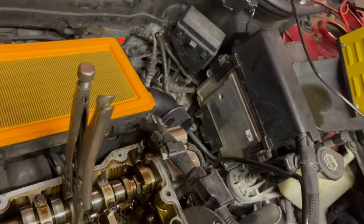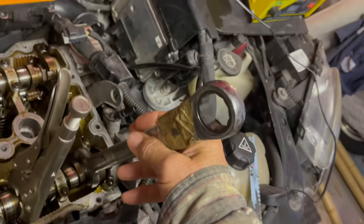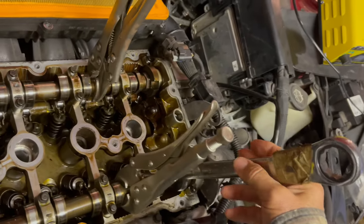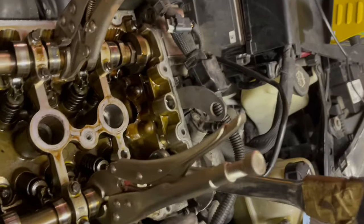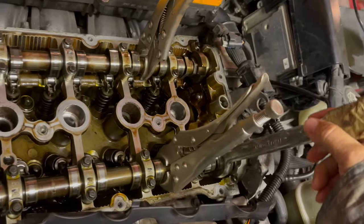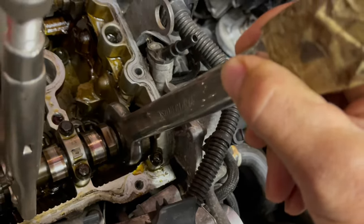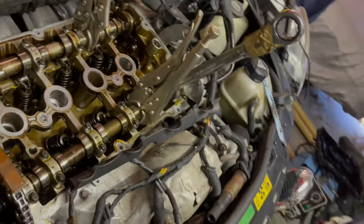You might find you need to move the position of the cams, so get a 27mm spanner. This is not how to do it without any tools — just without the special tools. A 27mm spanner is useful for the Mini oil filter and probably a few other jobs, and 27mm is exactly what fits on that hex part of each camshaft to turn it around. Just turn it until those flats line up.